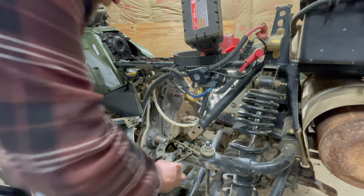It's hanging up on the very end, keeping that secondary engaged, so when we put it in gear it wants to roll, which makes it hard to shift. We're going to go ahead and shut this back off. So with this clutch - this was out of a 550 but a newer 550 - the idle is a little different on those, so I had to use the original weights and spring. But I'm thinking that spring is a little worn, so let's pull that back off.